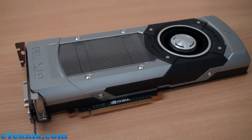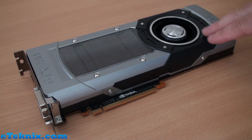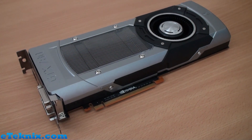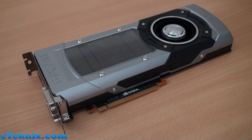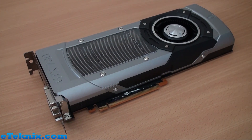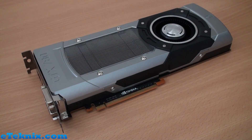We have 3 GB of GDDR5 memory on the GTX 780, whereas Titan has 6 GB — hence why you can't convert it. The memory speed is 1,502 MHz, which is 6 Gbps effective.